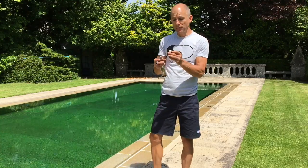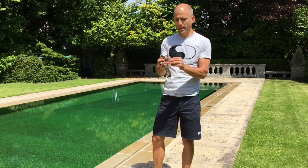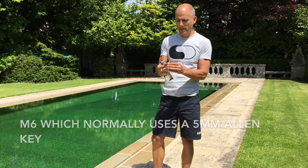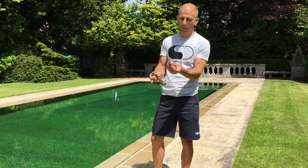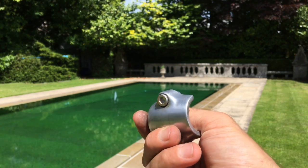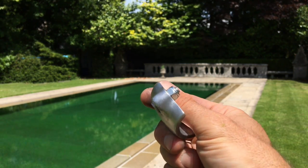Next up, what we have here is another aluminium bolt - same quality, same manufacturer as the smaller one. It's an M6 Allen key head, just threaded through this stem cap, and we'll see what it takes to break it. Again it has a steel nut on the back, so that should hold up fairly well - it'll be the aluminium bolt which fails first.